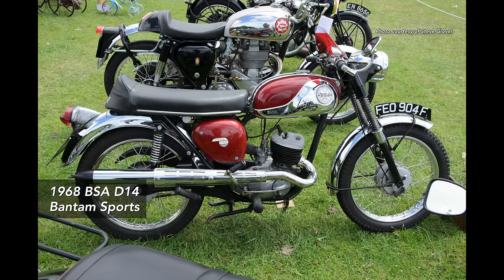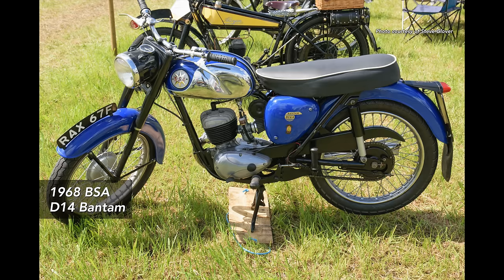When buying a Bantam secondhand, it's a two-stroke, and one of the main things with two-strokes is the crankshaft seals go very hard after a period of time. If you find the bike runs away from cold, starts up and then it's a job to restart when it's hot, and it lacks power, it always pays to check compression and make sure those crankshaft seals are in good order. Replace them — the bikes are pretty old now.